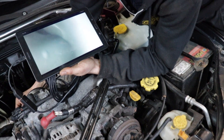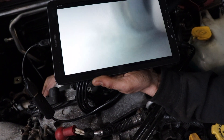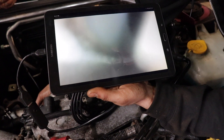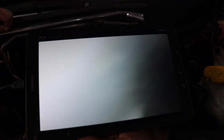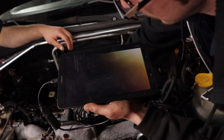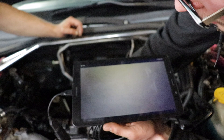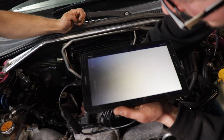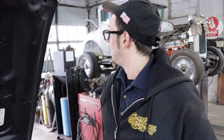Let's look at the screen because this is what we're dealing with - maybe we can record this and use it picture-in-picture. Make sure you guys are paying close attention to this video. Look at the compressor housing as we see it - going down the snail trail. That looks like a lot of oil. Talk about turbo leaks - they suck, you don't want them. At this point we're gonna pull this turbo off.